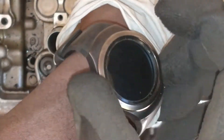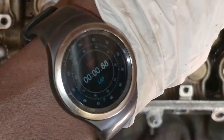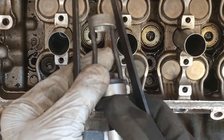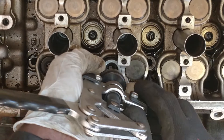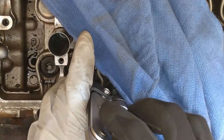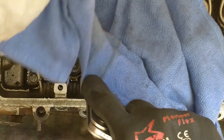Just for kicks, I want to time this and see how long each valve takes. Reset and start. The block of wood is already underneath the head supporting the valve. I have my tool — adjust it slightly, position it in place, make sure it's fully unlocked. Protect our assets with the rug, then wait for the pop. There we go — once it pops, make sure you maintain compression.